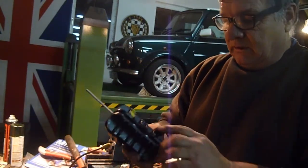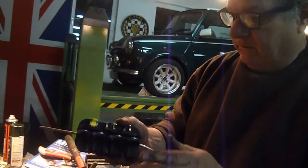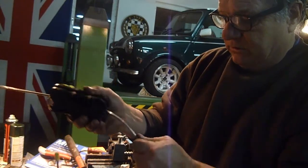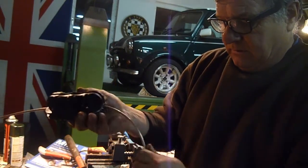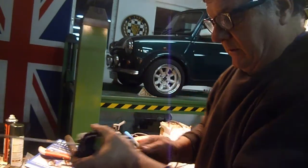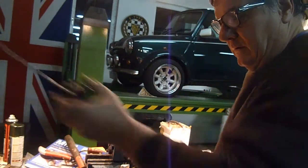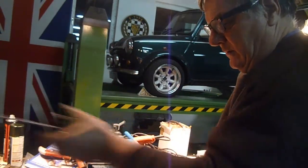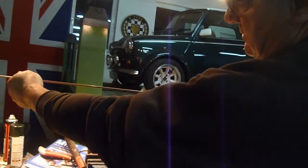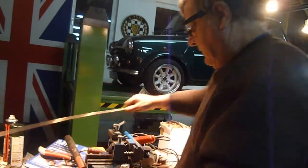As I say, they're called Quicks UK, and you can straighten the pipe unbelievably good. You can see it with the bend that's in that, and then what you basically do is just push that through. This is an old pipe that had a union on it, so you can see there, beautiful and straight. Any little kinks it just takes right out.